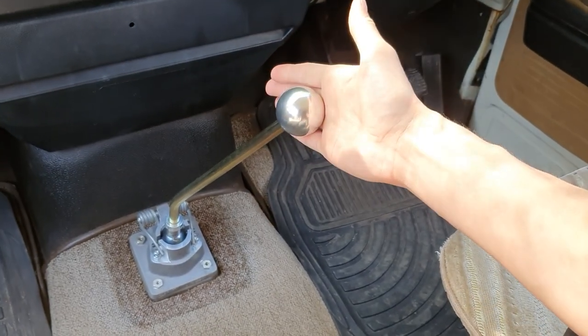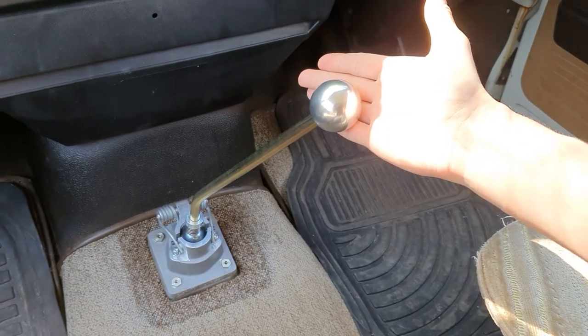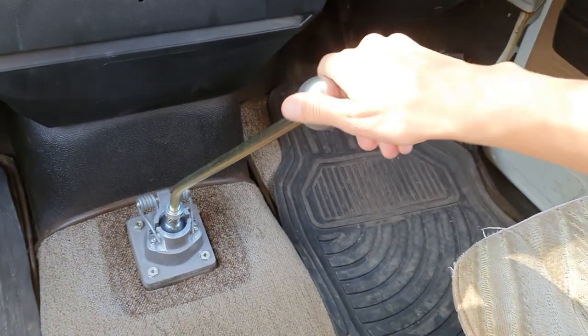So I've driven it around for a little bit and there are a couple of changes I'm going to make. First, I'm going to use the stronger spring on the return, because what I've found is that when you go over a speed bump it's actually clonking down the whole gear lever - the weight of it is clonking down. Hopefully the stronger spring will keep it in position. Secondly, I'm going to trim a little bit more off that return gate - that bracket that the weld hits - because although it goes into reverse it feels like it just needs a bit more to be fully engaged. I've gone for an aluminium gear knob which fits onto the 14mm thread - it now looks like one of the Terminator's limbs but I like it.